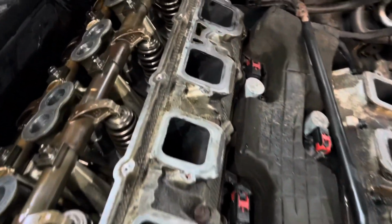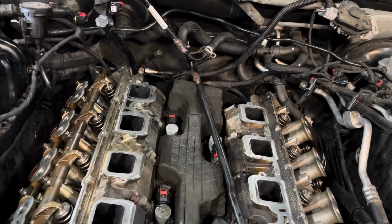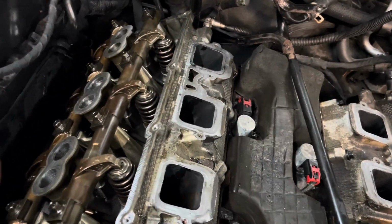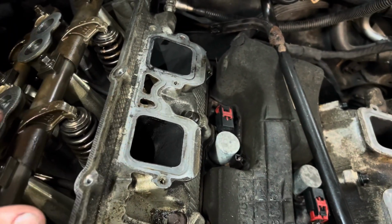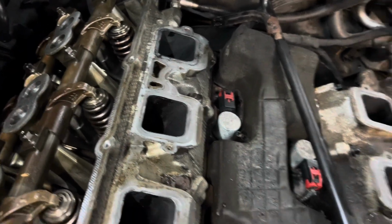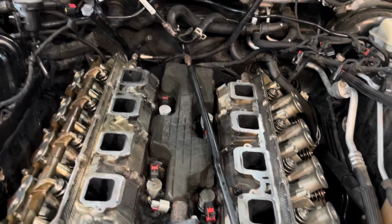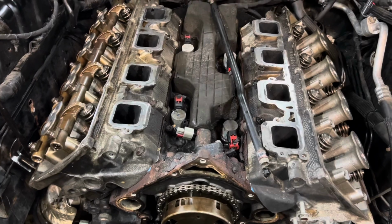One thing to know, you'll see I'm not doing the detailed build on this repair because there's a million of them on YouTube. You don't need to see me repeat what everybody else has already repeated, but I'll repeat it anyways just because it's critical. It's really important to make sure that your push rods are seated into the lifter correctly and into the rocker correctly. Once I get the other side all bolted up, I'll spin the engine several times and just make sure that everything's moving correctly and looks really good.